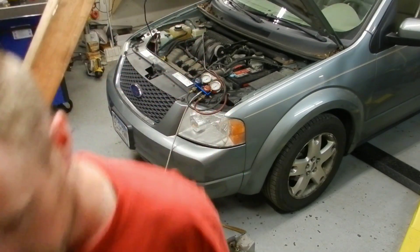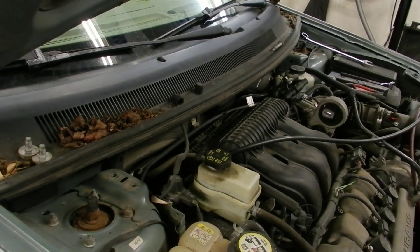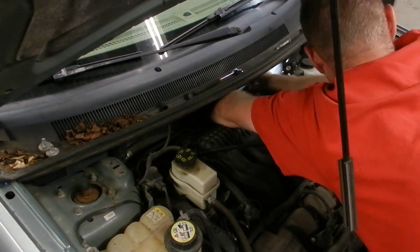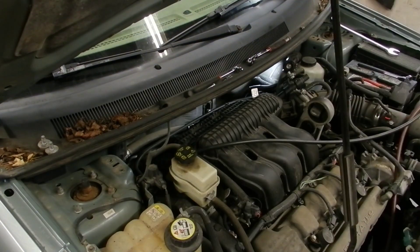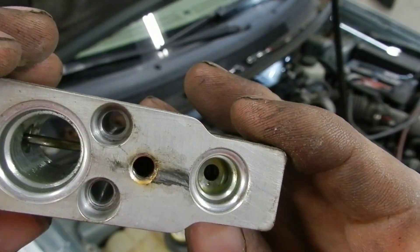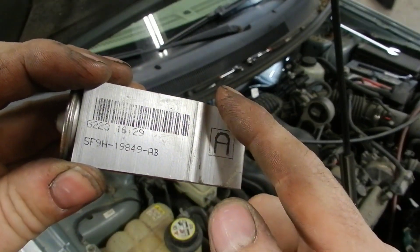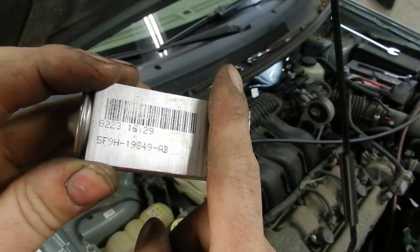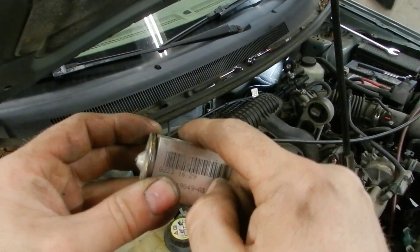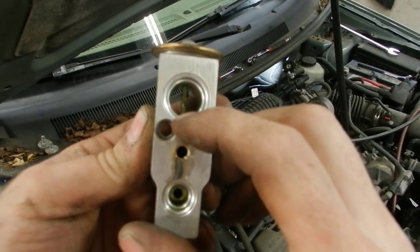I need to take this big bar off — it's in my way for that expansion valve, but once I get that out of the way it'll be nice and easy. Here is the expansion valve — this is the old one, you can see it's got its numbers on there. See how this side is lower than this? That's because it flows into here, down and out. This is the restriction from the high side going into the low side to cool down the Freon, because it's at lower pressure. It goes through the evaporative core, comes into here, and the temperature that comes through here activates this rheostat and controls where that pintle sits.